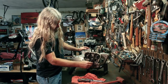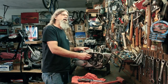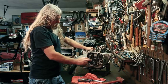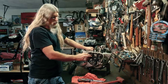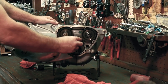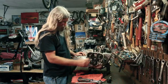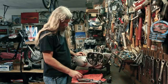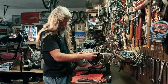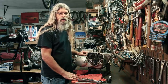Now we can gain access to removing these three nuts. Once again, left-hand thread. Since I don't have a compressor here in the garage — it's broken — I will be doing this by hand. I'll show you a nifty way to do this that works very well. The best method to lock these together and loosen these is to use an old pinion gear. I know what you're thinking — you don't have one. Well, you should maybe get one; it makes this job a hell of a lot easier.